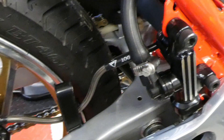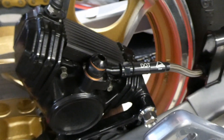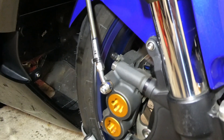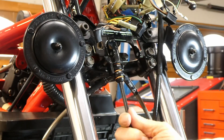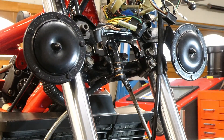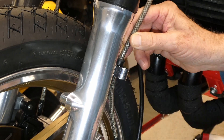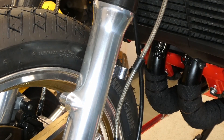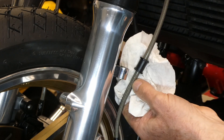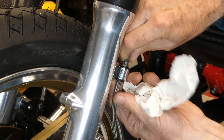Got the rear one on here. I suppose I could have made it a teeny bit shorter, but this will work. I'm really liking these black fittings — they look really nice. Here's what the chrome fittings look like; they look really nice too. I think I would have preferred the black ones on this bike — this is the 500. I put these brake line holders on temporarily so I can get these things adjusted to the right position. It's not quite right, so just a little tiny bit of soap water and these things slide on the brake line.